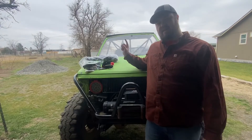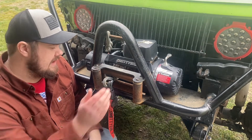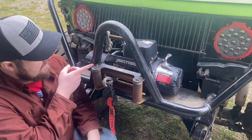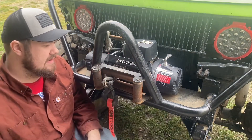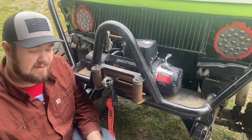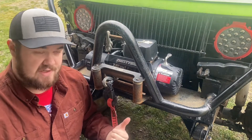I'm happy to be upgrading, so now let's get this installed. Before we can start swapping on the synthetic line we need to remove the steel cable line. I also need to cut off this roller fairlead — it's welded to the stinger — so we can swap it for a hawse fairlead. So we'll cut off this fairlead and build a mount for the hawse fairlead.